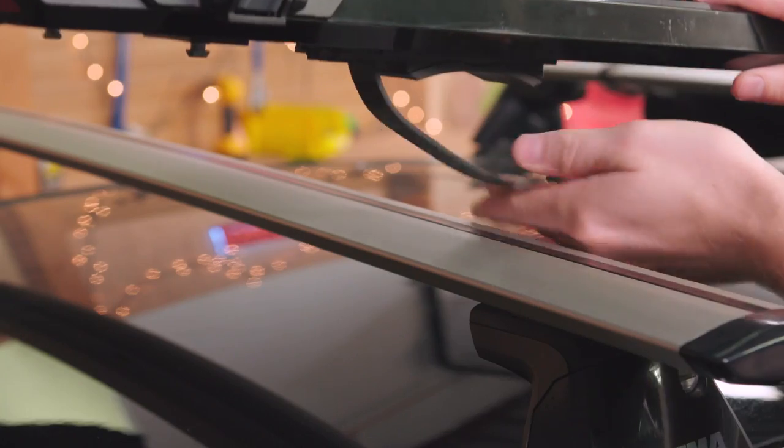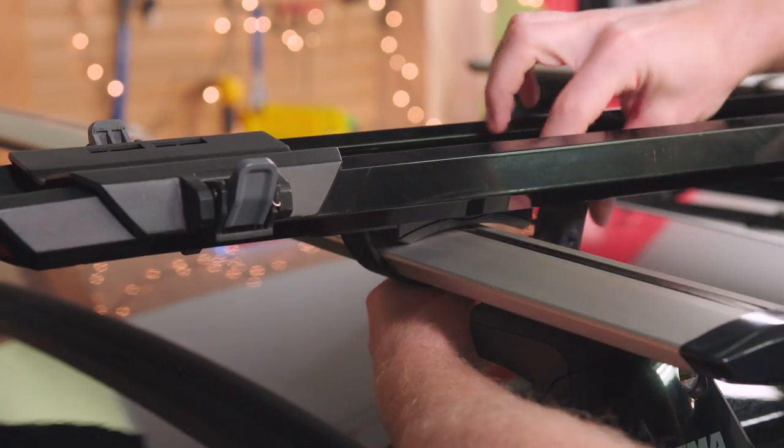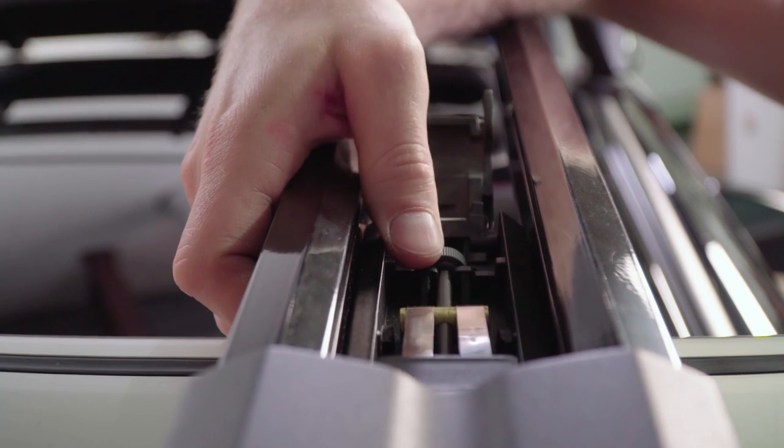Now lift the Highroad up off the crossbar enough to route the strap underneath it, and pull the lever back up through the frame. With the strap in place under the rear crossbar, hook the tabs back into the catch points, and adjust the strap tension with the thumb wheel.